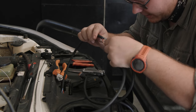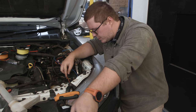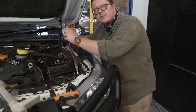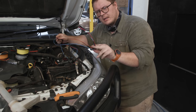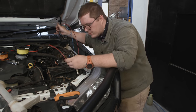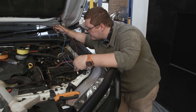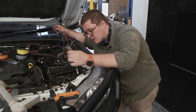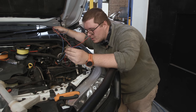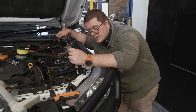Okay, that's all done — nice and strong. What I've done is run the spliced cable through, put some sleeving over it, and we've got extra length. I've also cut off three cables matching colors of these cables here. I'll strip the ends off, crimp these together, and I've left room here for whatever needs to happen — if we need to cut or pull or do whatever we need to do. So all three of these cables will be extended from the light. The blue one doesn't have to be so long because it's going to tie into the park light. Now I'm going to crimp the red and black from the lights, and those are going to end up going to our relays.